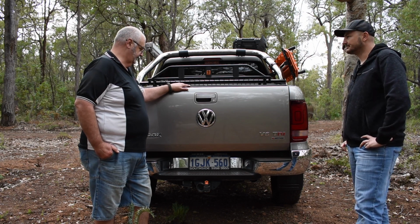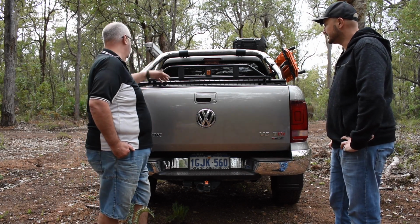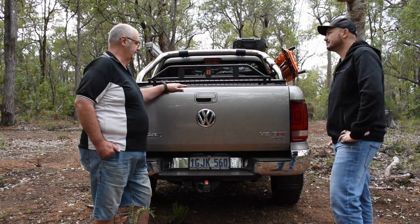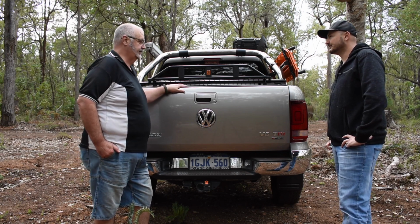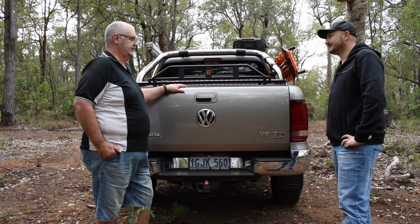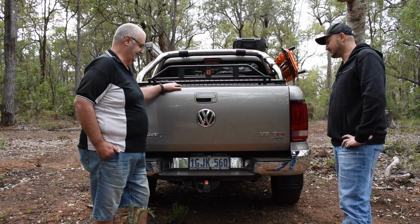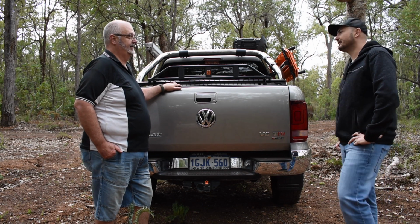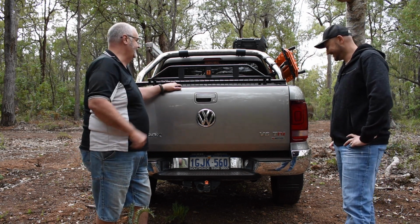Yeah, no, and that's fair enough too. We were having the discussion before. You put 150 kilos this far back of your axle, and it's probably not the most desirable, particularly for handling, but more so for your subframe and chassis longevity. The upshot of it is I get an extra 10 mil lift in the front when I put it on.